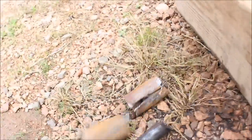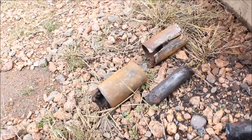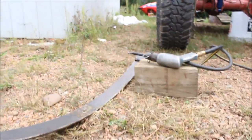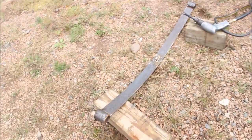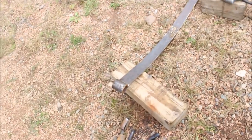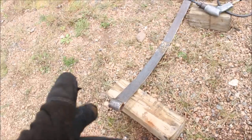And that's how to get a bushing out the easy way. Bushings out — you just slice it down the center and start folding the edges out and they come right out. Quit wasting 10 minutes using a press or some other method when you can just use an air hammer. You can pick one up at Harbor Freight for probably like 30 bucks. If you absolutely have to, you could use a propane torch but it would take a lot longer to heat up. Sometimes if the bushing is rotted enough you could even punch it right out with the air hammer without heating. I tried it on the other one without heating and it didn't work as well. So there you have it — easy way to get your bushings out. Now it's time to repaint these springs along with the others so we can fit them on the front of the truck.